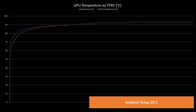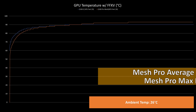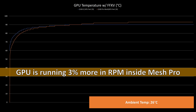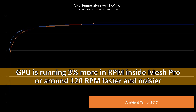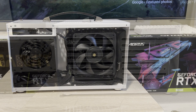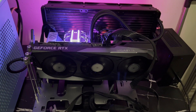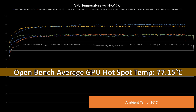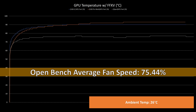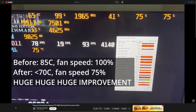As for fan speed, in the mesh pro the GPU fan was at an average of 89.22 percent with a max of 93 percent — just 3 percent worse, which is also around 120 RPM faster and noisier. The results were unexplainable to me as to why I see a huge improvement in CPU but not much in GPU. I retested the GPU temps on my open test bench and it averaged at 66.5°C while the hotspot temps averaged at 77.15°C, with fans at an average of 75.44 percent.